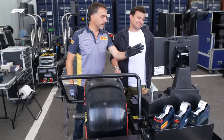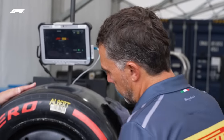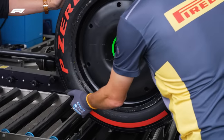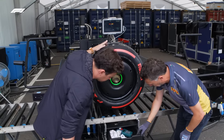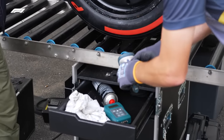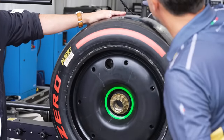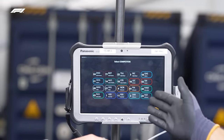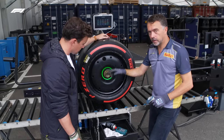The tyre is fantastically balanced, so now it can go on track. Last stage: we have to check that the sensor is working properly. The sensor receives a signal on the top, with a monitor on the bottom. What we have to do is scan it and select the competitor. This will link the sensor to the tyre and to the rim, so we have all the set together.